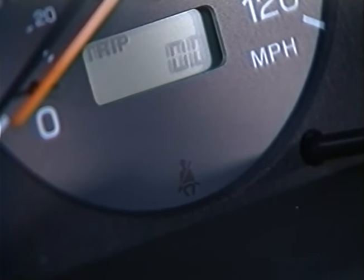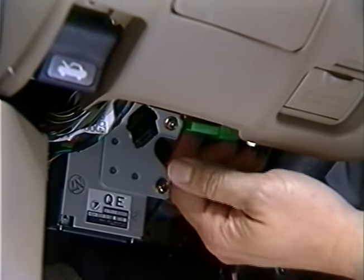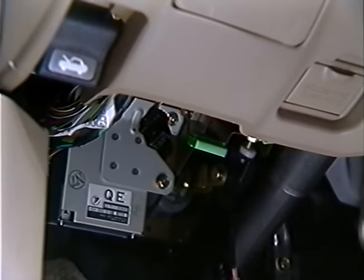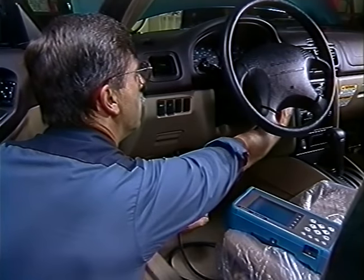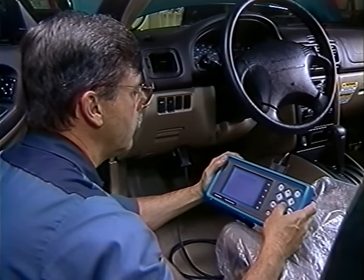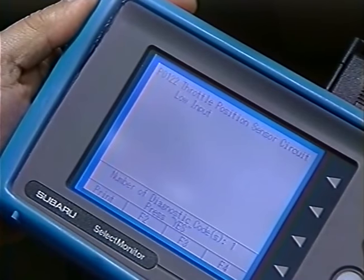Check the front passenger's seat belt as well. If the check engine light blinks at a rate of three times per second with the ignition switch on, the green inspection mode connectors under the dash panel are still connected. Turn the ignition switch off and locate the connectors, disconnect them and tuck them back under the dash panel. With the ignition switch off, connect the new select monitor to the data link connector under the dash. Then turn the ignition switch on and check for diagnostic trouble codes or DTCs. If necessary, clear the memory. Leave the new select monitor connected for the road test.